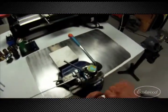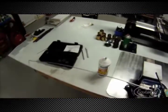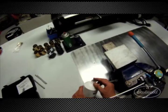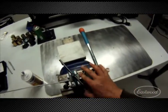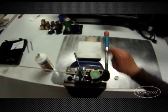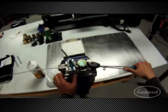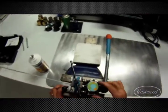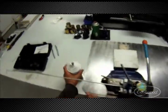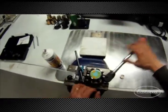Always, always, always lubricate. Never use anything other than brake fluid — why would you use any other type of oil and risk cross-contamination? What I like to do is just get a little bit of it and go right onto the die there. What you're lubricating with is the exact brake fluid that's going to be in the system. And then simply, once you pull to the stop, go to Operation 2. 3/16 Operation 2, right here. Give it a little splash of lubricant, spinning around.